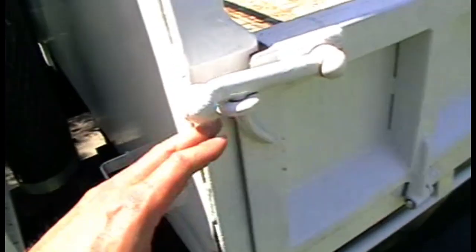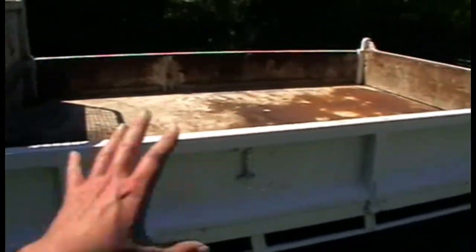The actual build, I kept tossing up between wood and steel for the framing of this thing, and I've gone back to steel. The steel will be 50 mil steel, which is this. So you can see, square 50 mil. It's quite chunky, very strong, and I've already got the system of getting into it. So you can see where the sides come on. The tray will be cut down about here, and the actual camper, the 50 mil, will slide inside that. It'll be made to just fit inside here. So what I want is to be able to slide this whole thing off and on.